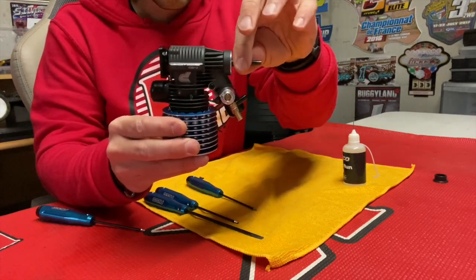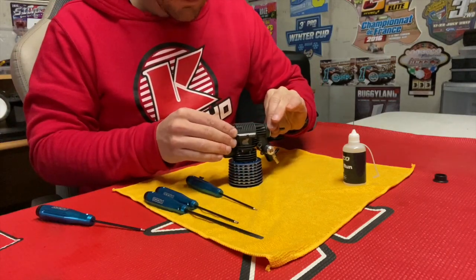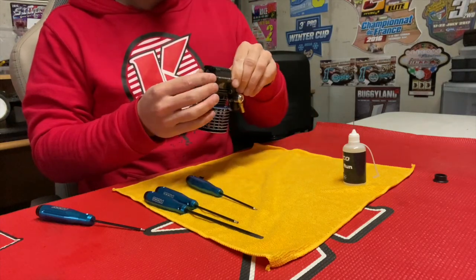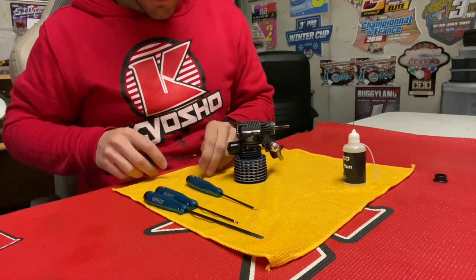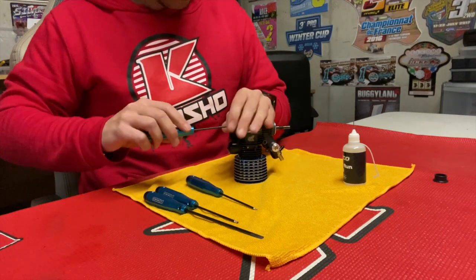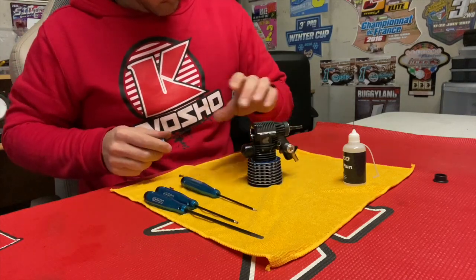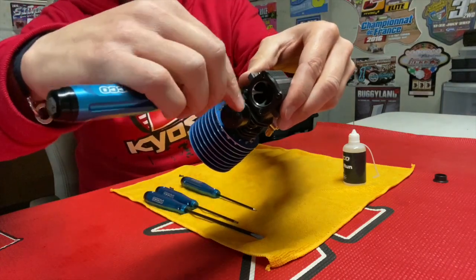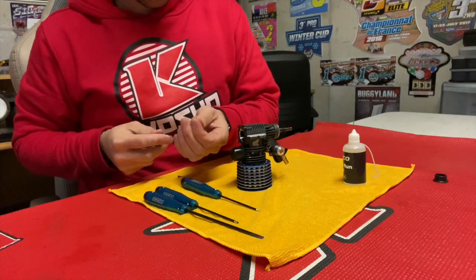To put the backplate on, you can place it and then make sure always the same. Like I go back to the hard spot, so the piston is really on top of the piston sleeve, and then I push the back plate in. Usually you have a flat spot on the back plate. Make sure the flat spot goes on top versus the cooling head, and then you can screw the screws back in. Usually you don't go to the end, just tighten it a little bit, and then you cross to the opposite side, and then the third one and the fourth one.